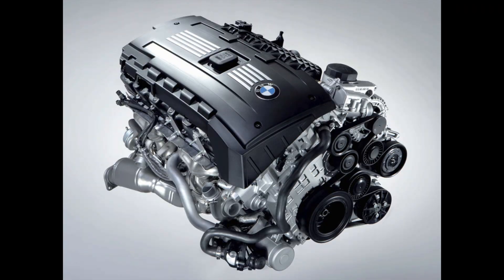The M2 version also has a dual-stage oil pickup, which is probably its biggest benefit. The N55 features an open deck design, meaning it's not quite as strong as the N54. The M135i and M235i share the same long block as the M2 non-competition but don't have the dual-stage oil pickup, and have a different turbo — pneumatic on early 2013 M135is, electronic from 2014 onwards — still slightly different to the M2 non-competition.